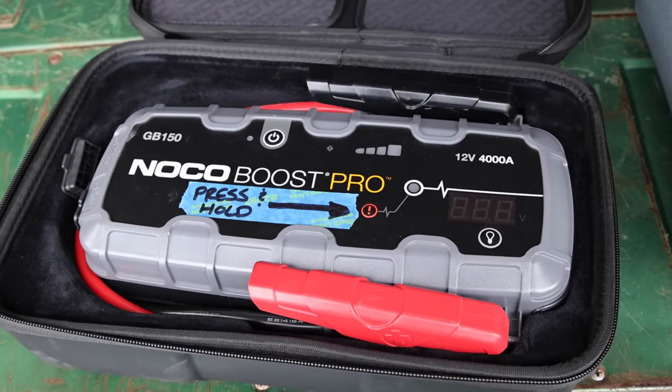Now let's talk about some of the incredible work that's been done. One of the first things I did recently was swap out the old alternator, because the original one was barely pushing out 13 volts and a new fresh one was in order. This was a relatively easy process, but because the Cherokee has air conditioning, things were a little tight. With a little persuasion, the new one was installed and it works perfectly.